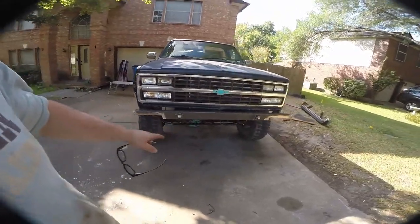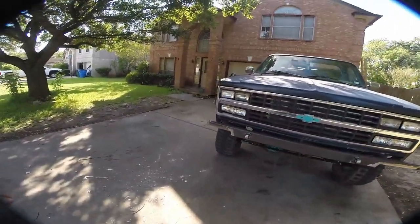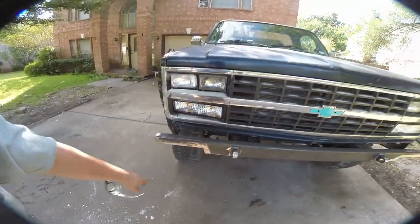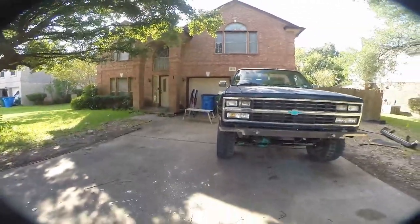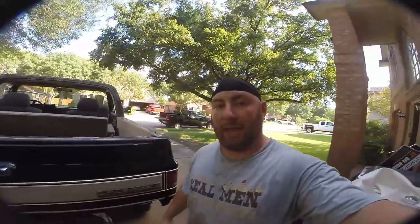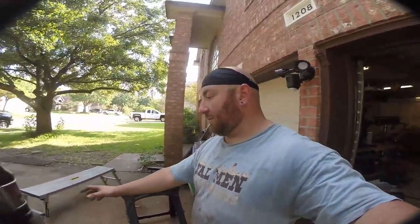We saw us build that in the last video. The only difference on the rear bumper versus the front is we cut two inches up on the front to give the front approach angle as much space as possible. On the rear we will be only removing one inch at the side, because the spare tire carrier has got to go here and it's kind of beefy — we want to give it as much meat and muscle to bolt into as possible because it's got to support quite a bit of weight.